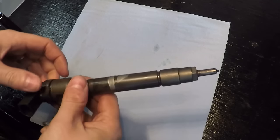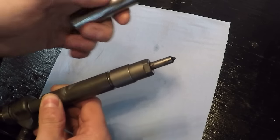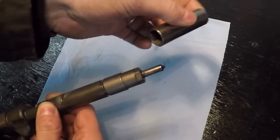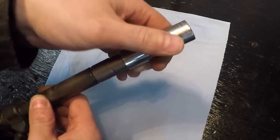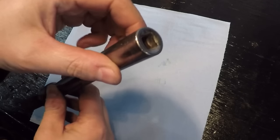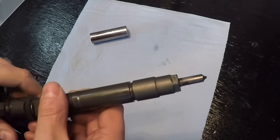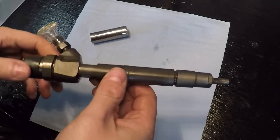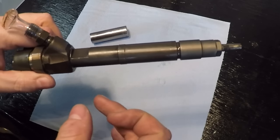Today we're going to be delving into what some might deem to be a little bit beyond the realm of DIY-able. I'll get into why that is and why I feel the injectors specifically are more DIY-able than anything else. The pump itself is very simplistic. Really the only thing that goes bad in them that can be fixed is if you have bad seals, bad o-rings, lip seals, stuff like that.